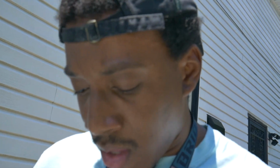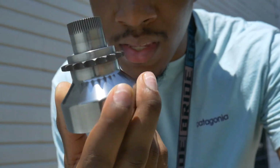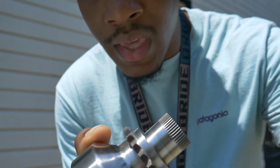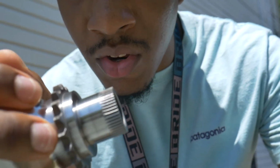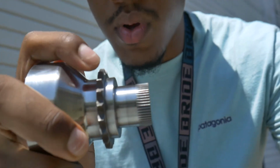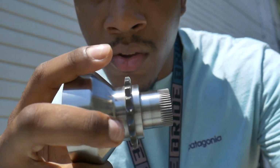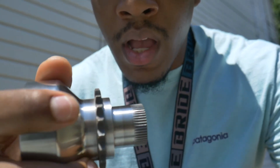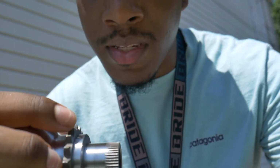But yeah, the big fuss is over this piece here. I'm gonna unwrap it, so give me 2 seconds. This, if this will focus, is the Vargas crank hub. Now the difference between this and the stock one that we'll show you later on is that this comes splined. If you see the splines on the end of that, that will actually twist into your crank hub, if I'm correct, helping it hold a lot better if there are any signs of slipping. This piece usually comes as a separate sprocket altogether, and I believe they go to your oil and cam timing. There's another ring that's supposed to sit on the other side of here, but this one is pretty important. I believe this might be the timing one.